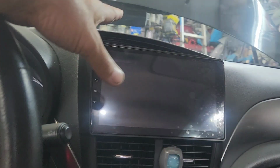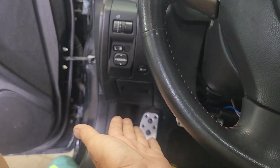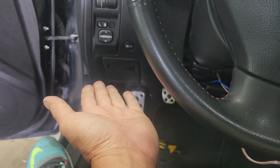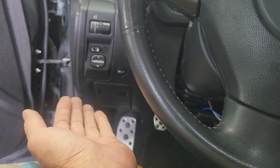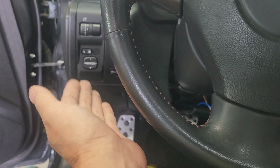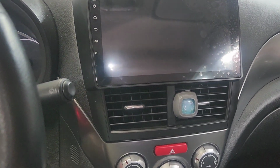To take this Android, this is an aftermarket radio, so I ran the remote wire and the RCA jack out here. And if you don't have one, you can go to the fuse box and look for BCM or ignition. You might need a test light for that. For the line out converter, you can use the model that I'll be using every day, called the KISLOC 2. That's got a remote output if you hook it up to any one of the speaker wires.